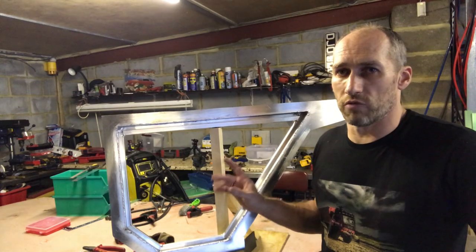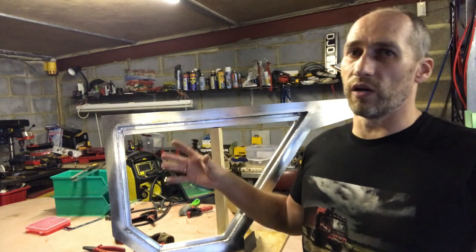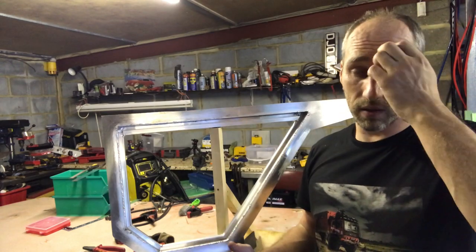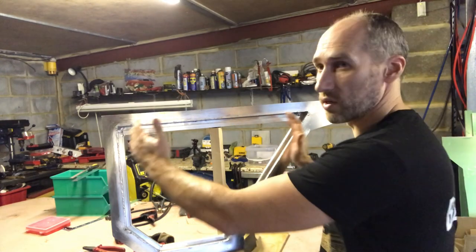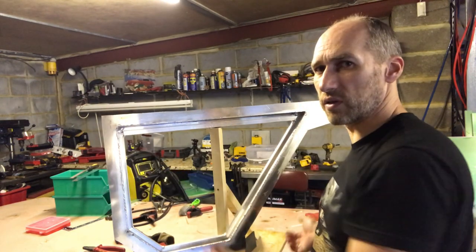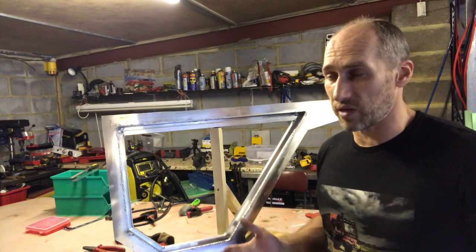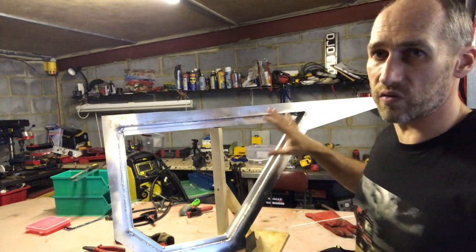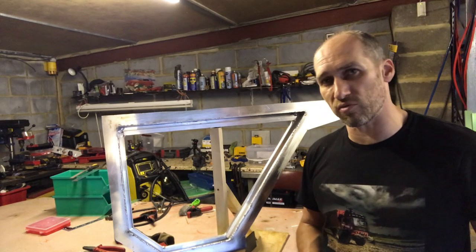This is the front face of one of the rear lockers and I've welded in this internal gutter channel. There's a simpler way to do this - I could have stuck it on the outside and had the door cover the gutter, which is quite a common way for commercial truck builders to do it. But this is going to be visually nicer, with the door flaring around the inside. I'm quite pleased with the way my welding has progressed - there's lots of welding on here. There are some nice welds but some need tidying up. It'll all be painted when finished so I can hit it with a flap wheel, tidy it up and paint it.